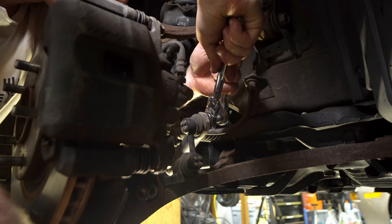Get all the bolts in place — the upper control arm bolts, the lower shock mount bolt, the upper shock bolts, and the end link bolts. Then preload the suspension arm with the floor jack and torque all of those bolts. It's really important to torque your end link bolts and upper control arm bushings with the suspension loaded, or else the bushings will fight you and affect your spring rate. 22 foot pounds on the 14 millimeter top nuts.